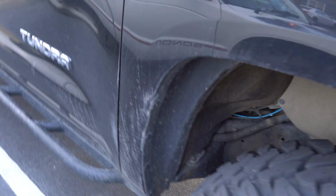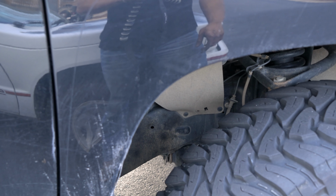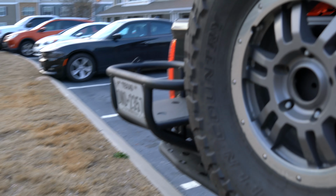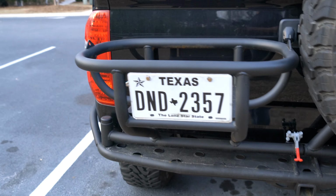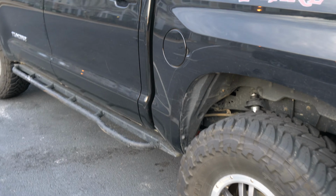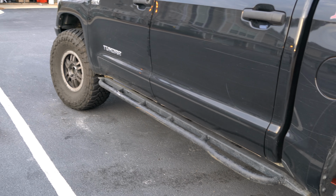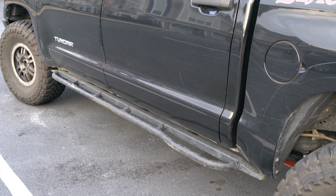I'm gonna go ahead and just rip apart those CV axles, pull them out of the diff, change the front diff fluid, and replace the boots with some from SD headquarters. They had CV boots for the Tundra made out of a racing material that they use for racing trucks. They have them for the stock parts, so I thought I'd go ahead and purchase those. Like 3 times as much as normal boots, but I don't ever want to rip the diffs apart again.